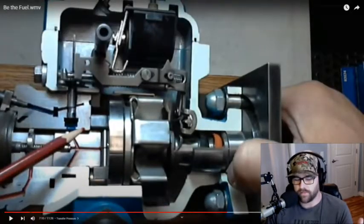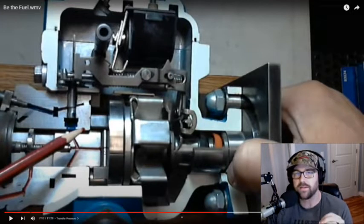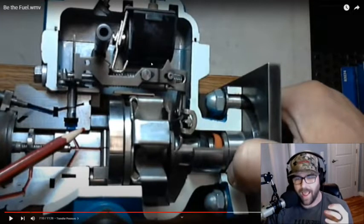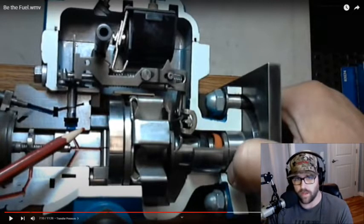An expert who I talked to about this on the forum called Diesel Place says that the issue is that these two plungers right here are stuck together. What we're going to try to do is hammer on the outside of this pump with an air hammer and get as much pressure as we can forcing into this whole unit so that we can force those two plungers apart, because I believe that is the only issue we're dealing with. We're getting fuel out of the return line, which means the transfer pump on the injection pump is working. There is fuel moving through there. So fingers crossed, with a little bit of hammering and possibly fuel pressure, we could get this to work.